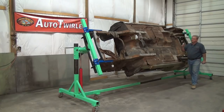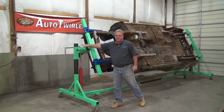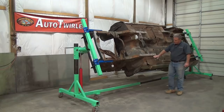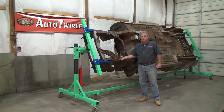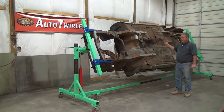We can put this at any angle we want. There is a bolt here on the pivot if you want to lock it down and keep it secure. If I want to scrape off the undercoating on the bottom side of the car, it's a lot easier to do it in this position and have that debris fall at my feet. Also, if we want to do some sheet metal repair, replace some floor pans, we can do it here in this position and any sparks from the cutting wheels or the welders would be out here in front of us. We can certainly disassemble while it's on the rotisserie and do some reassembly work, and definitely we want to be able to paint the bottom side of the car while it's up on the rotisserie.